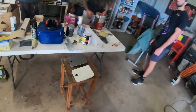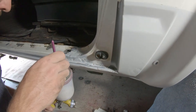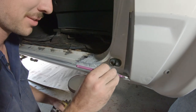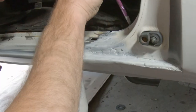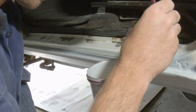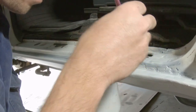Nearly forgot the cap — this is the cap that was on the shorty. It's got a bit of a ding in it, but that's a new one, a little bit straighter. We've just got high build primer, and we're putting it on the bits that we've repaired with a little paintbrush to help seal it up. The reason we're priming this now is because it's getting late in the day and Hakeem lives about an hour away and has to drive the car home. We just don't want bare metal around when he's driving home. We still have to do all the bondo work, which we'll start tomorrow. From there, we'll sand it all back, put a guide coat on it, sand the guide coat off, make sure everything looks hunky dory, and then spray some colour.